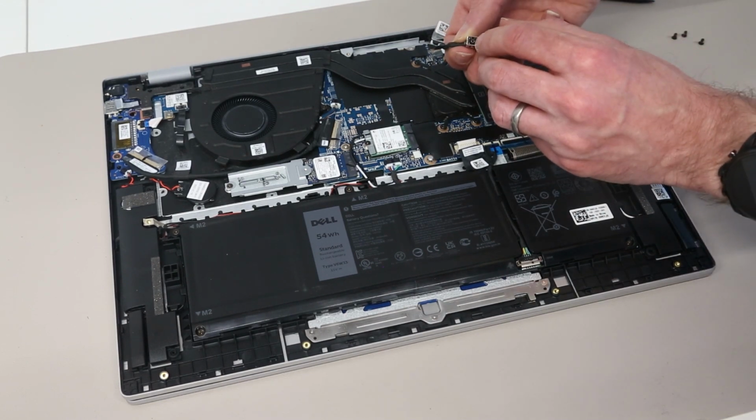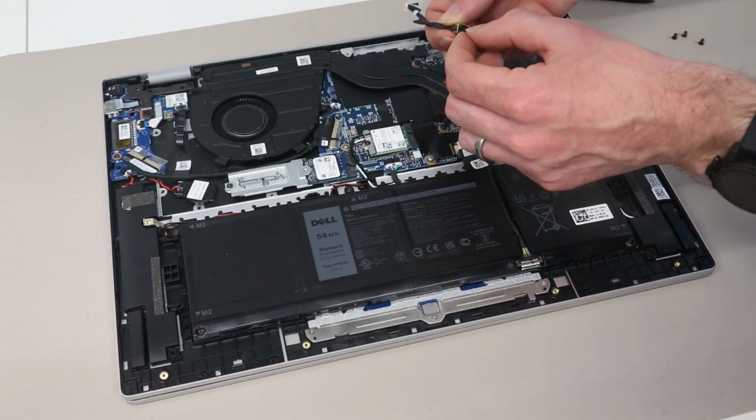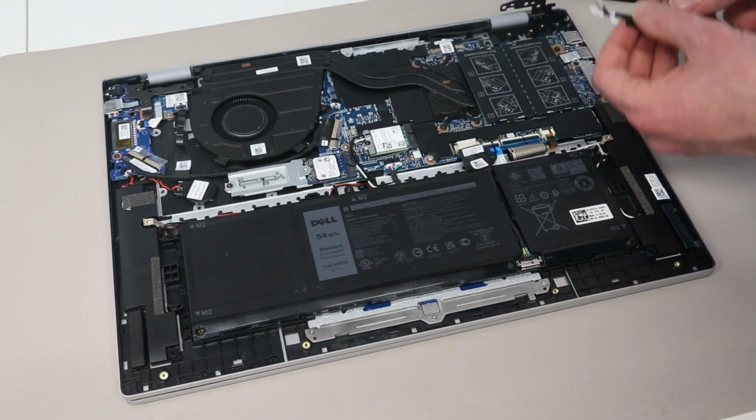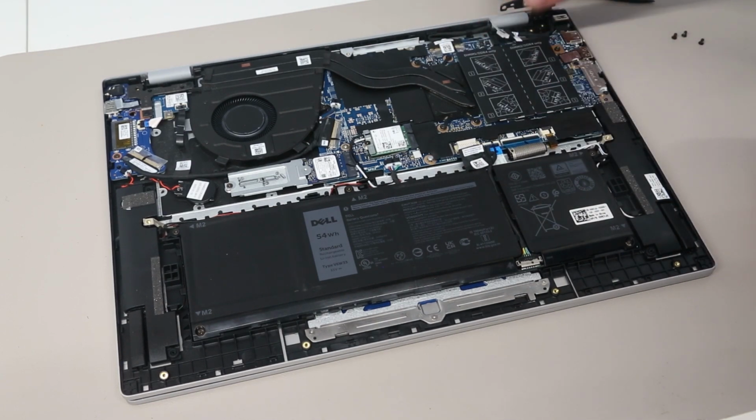Often you find like the little inside of this connector gets broken if the cable is wrenched, say if it's tripped over while the laptop is on charge, and then if you're fitting your replacement you simply press this back into place